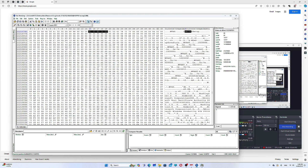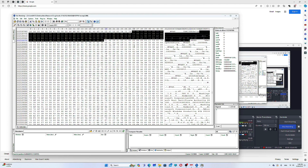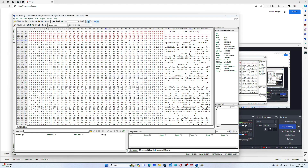Let's try to find another one. We have something here — as you can see, we have 'AMITSE setup' and we have 'NVAR.' So we have data in between these two markers. We need to fill everything from the NVAR to the setup with zeros instead of these values. I'll fill it with zeros — press OK. Now as you can see, everything is zero from the NVAR to the AMITSE setup.